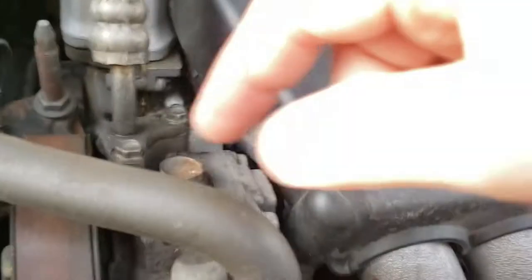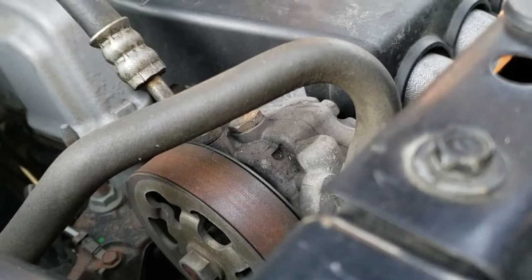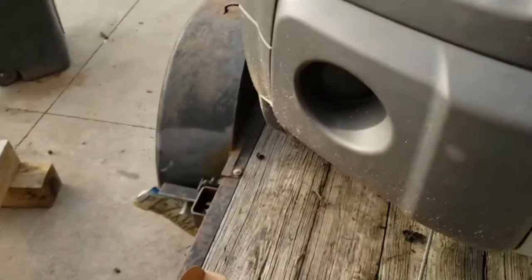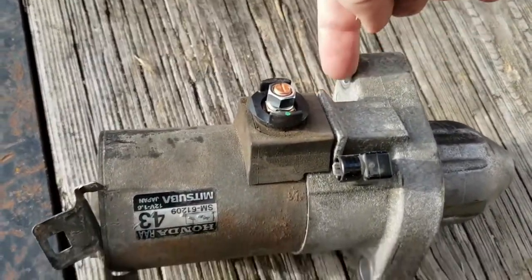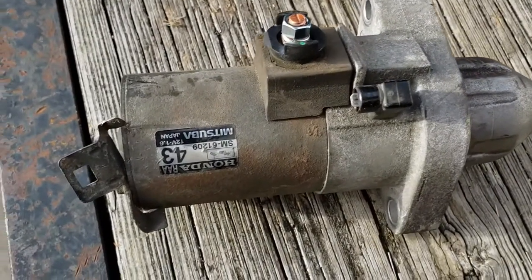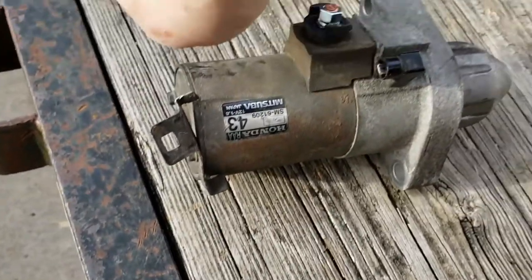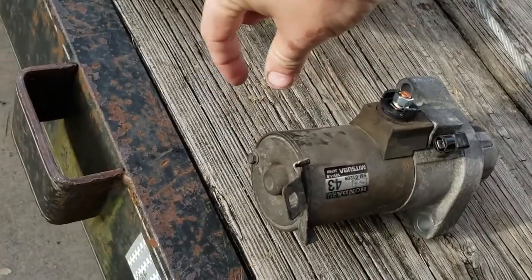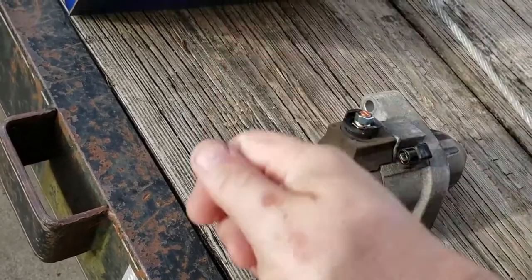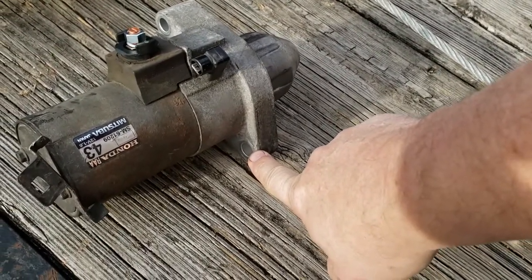To get to the top bolt, instead of taking off your intake, there is a possibility of taking off your power steering pump and using an extension to hit the top bolt. If not, you have to hit the top bolt from the bottom — it's a 14 millimeter that sticks out about here. You need a 14 millimeter deep socket, 3/8 drive, to get over it, and you kind of have to hit it blindly. Get your hand back in there to get the drive over it, then get your 3/8 on it and it's fairly easy. The bottom one's a 17 millimeter.